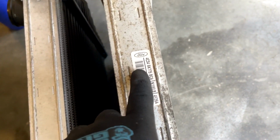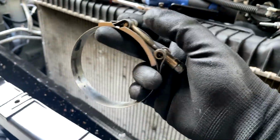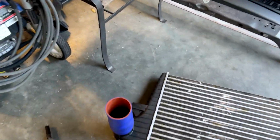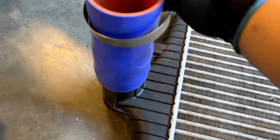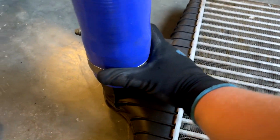This is like 2.5. And there's a part number there if you guys are interested. But yeah, instead of adding the clamps, because they're like another $30 a piece, what I did was I took one clamp off the cold side, the ones that had the springs on it. I was going to try to use one of this style, but didn't have enough throw there, so I took one with the spring, loosened it up, and then you guys can just use a factory clamp that goes up to 3 1/4, that goes all the way down, no problem.